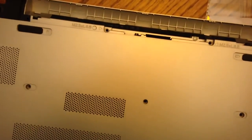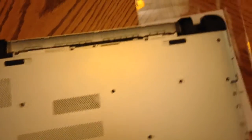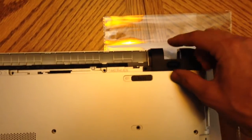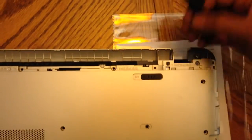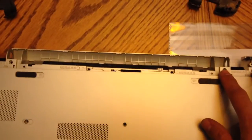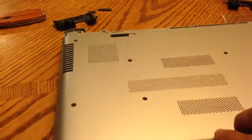The trickiest part is that on laptops I've worked with previously, you take off the front keyboard. But really, to open up this one, once you get these two screws out, there's no screw underneath that rubber foot. You can pop these black corners out, and then you have two more screws under each one of these you have to take out. As far as I can see, all of the screws are the exact same length — don't quote me on that, but it seems to be the case.